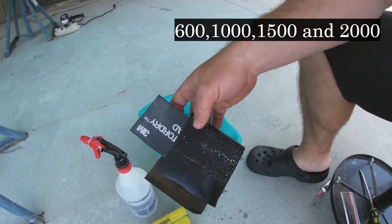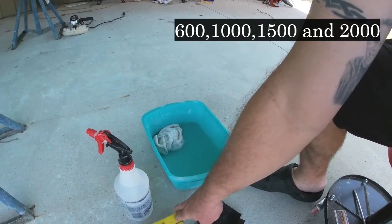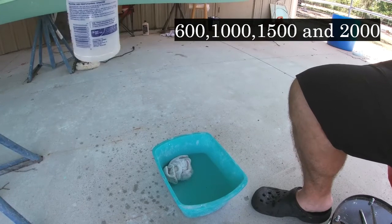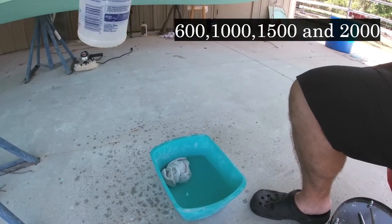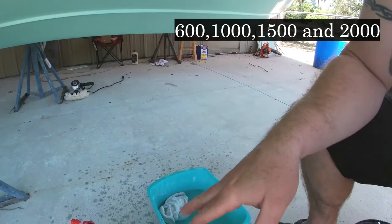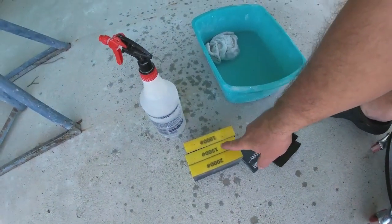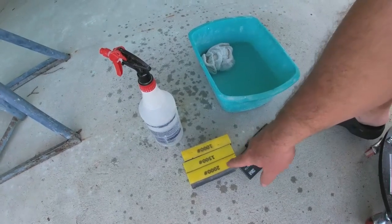We're going to go through a series of sandpaper. We're going to start out at 600 grit sandpaper, then sand that down. Keep the surface wet the whole time — it's good to keep all the surface area wet the whole time. Otherwise you can burn through your paint. Keep that surface wet — have a good spray bottle to spray. Once we get done sanding at 600, then we're going to move to 1,000. Once we get done with 1,000, we're going to move to 1,500. And then we're finally going to finish off at 2,000. This sanding is not to sand all the paint off. What you want to do is get all the rough area off, so it only takes a few seconds to sand it down. Once you feel that it's sanding smoothly, stop and clean that surface area and move on to the next grit of paper.